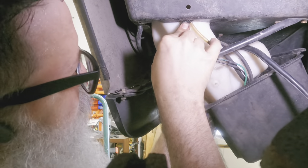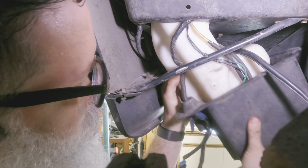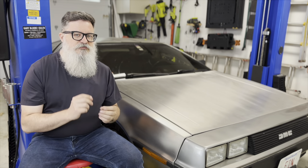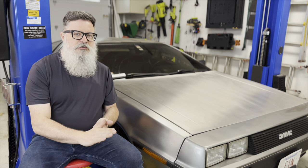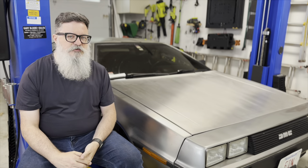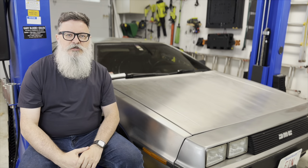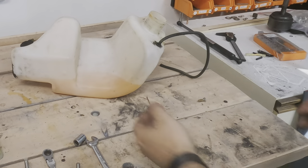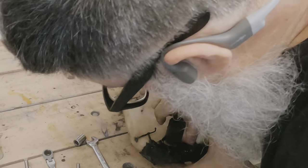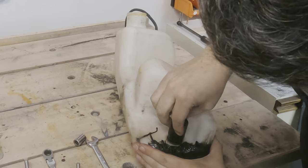After dealing with that, I'd have to Tetris the bottle out of the car without getting snagged on any of the hoses or wires. Then I could actually deal with the leak, which wound up being an almost invisible hairline crack on the bottom of the bottle that I could only find by filling it with water and watching it seep out. These bottles are hard to come by, so instead of trying to replace it, I tried to fix it using a Permatex plastic tank repair kit. This actually worked really well — I tested it by leaving it filled overnight and it didn't leak at all. The next problem was that the washer pump was bad, but that just screws into the bottle and is easy to replace with a new one.